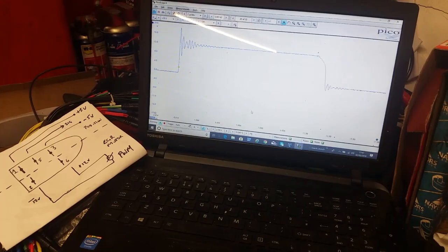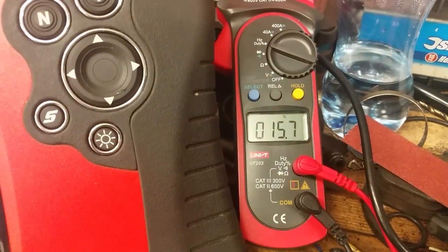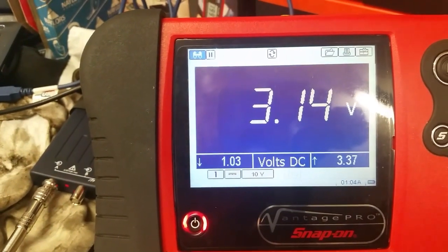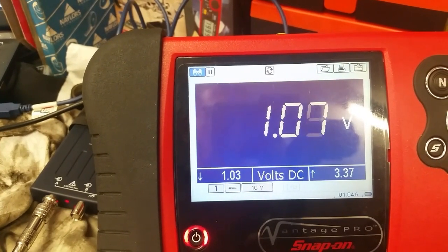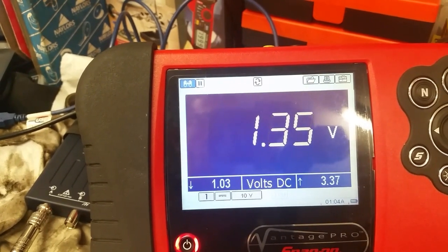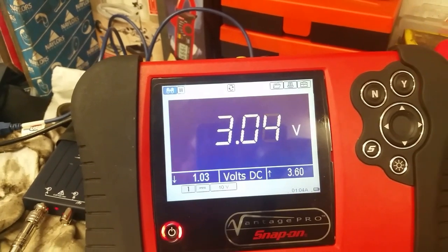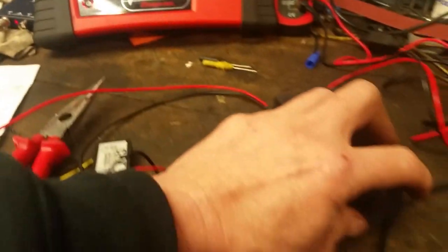There's that happening, and as we're doing that I'll bring you over - there's our duty cycle signal and percent. That is our position sensor signal output. It's very sticky, this EGR - it's not working very well, so it's not going to drop very quickly. It'll just show you the actual arm moving about. And that's it off again - you can see the position sensor is still half open.